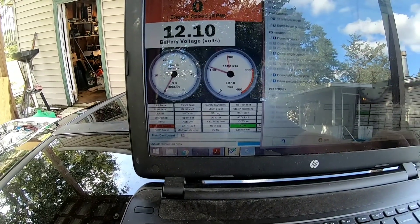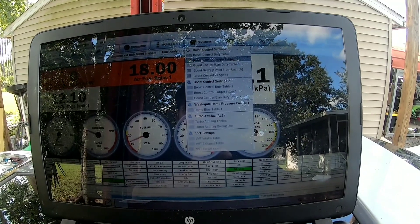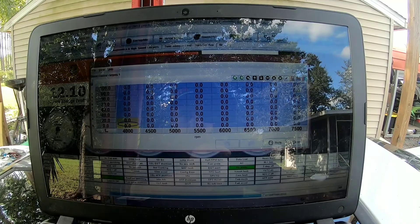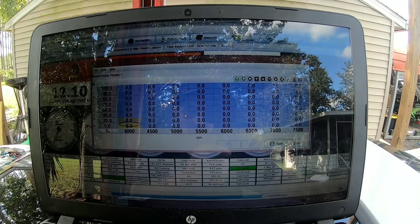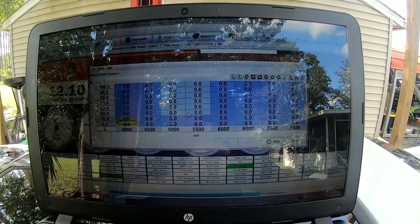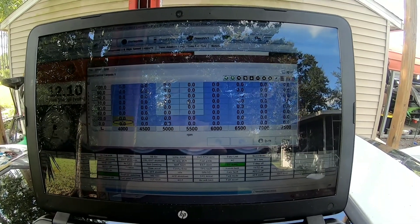The first thing I'm going to do is go out and see what my wastegate springs make boost-wise. This table here is based on throttle percentage versus RPM, and this is where I'll put the desired amount of boost. Let's say it makes eight pounds now and I want 14 pounds - I would take these cells based on throttle percentage by RPM and put it at 200 kPa, for instance. I'll just have to play with this and watch data logs to see what kPa here makes what actual manifold pressure.